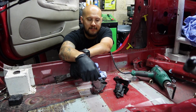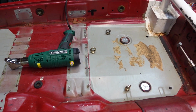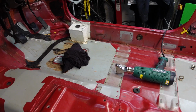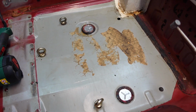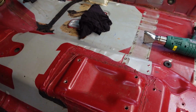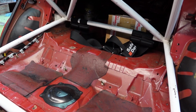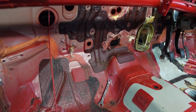Right, wish me luck. So that is the driver's side done and a little bit of the tunnel. It's come up quite well, but that's taken absolutely ages. This stuff is 6.5 mil thick in some places, and where we have seam sealer randomly on the panels, it really sticks, and it's taken quite a while to get that all cleaned up. This rag here is soaked in white spirit to get all the residue off. I've got this side to do, the back there, there's some in the boot as well, and I don't know how, but I've got to get all of that off as well.